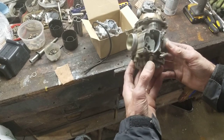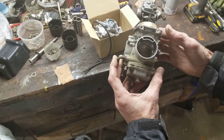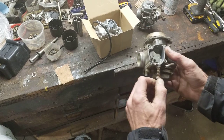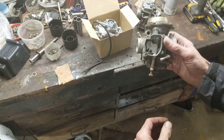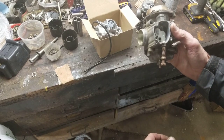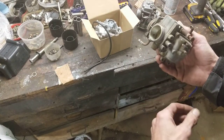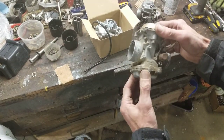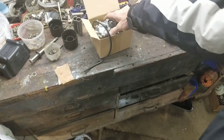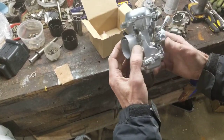Once in a while you just got to give up. If you've got a carb that's been sitting for a while and won't even move, that's junk — unless you own a sonic cleaner, which might be able to get it cleaned up. You have to ask yourself what your time is worth. You could spend three or four hours cleaning a carb and still have it not run right, because without a sonic cleaner, carb cleaner alone won't get all the ports clean.